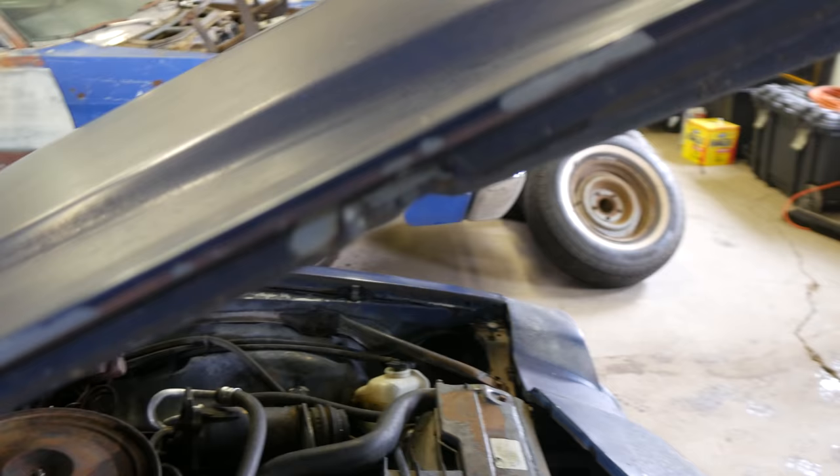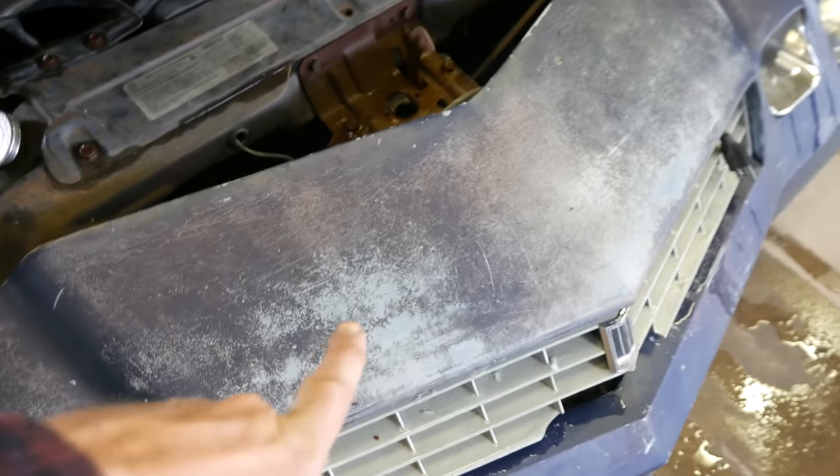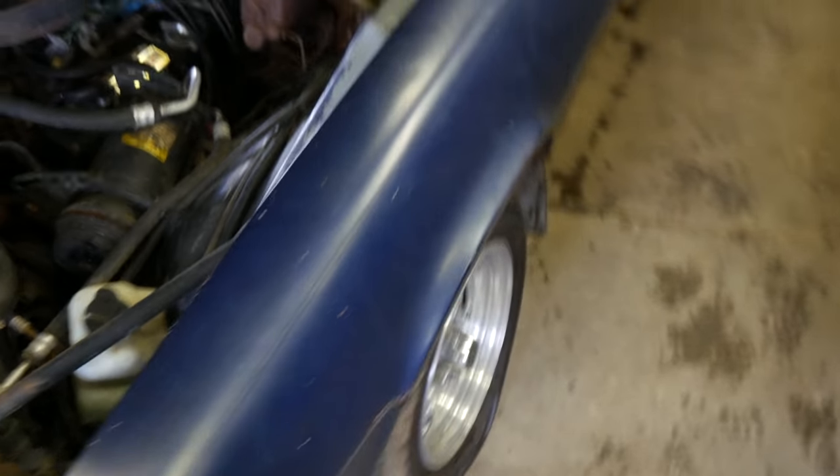And it's definitely a single stage enamel, and they didn't even bother to prime it. You can see that here. Well, light's kind of bad, but they just shot right over the factory color. So she's flaking through everywhere. And the pressure washer's blowing it off the nose cone here. So there's not a lot of paint on her. I mean, it's thin. It's real thin.